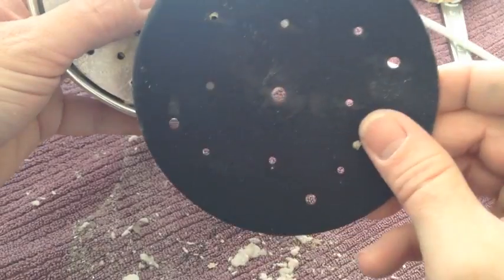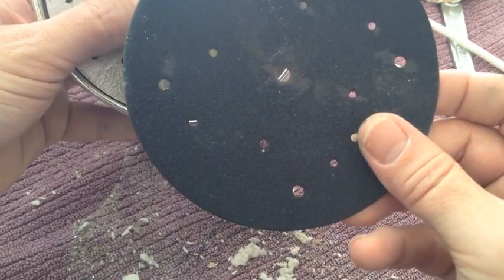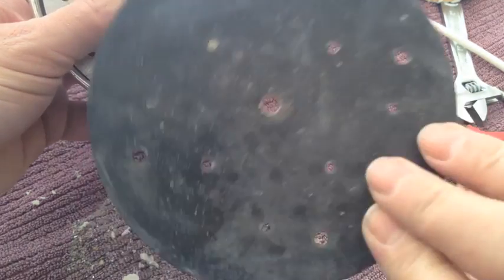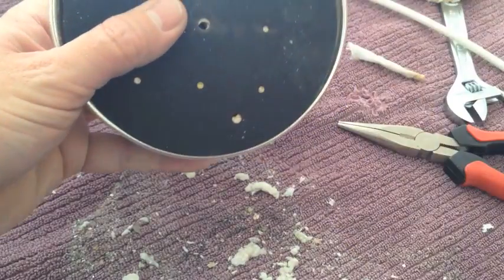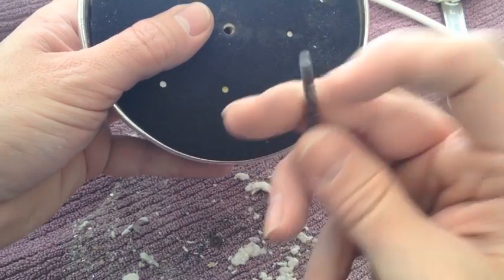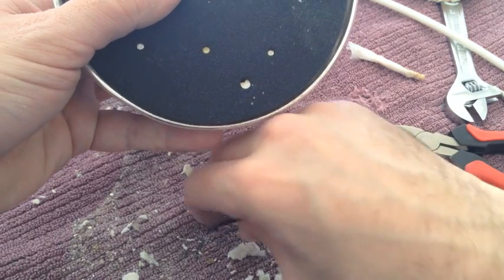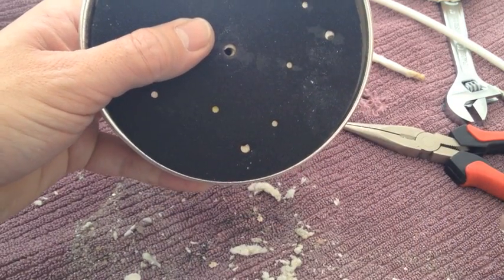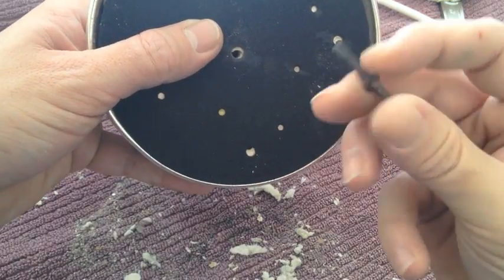These mineral plates can also be bought and replaced. They usually go a very grey colour when they're no good, but they tend to last quite a long time — there's no need to replace that one today. So we've put that back together and we'll take this screw and pop that back in. The centre hole can be a little bit fiddly to line up.